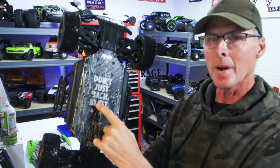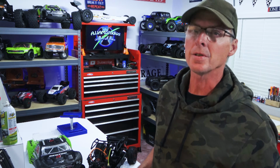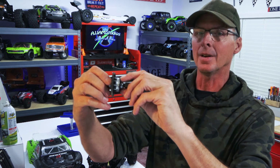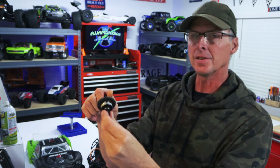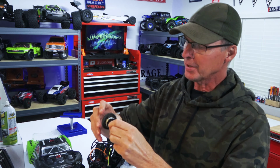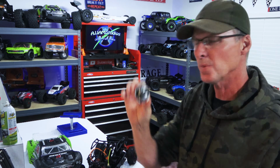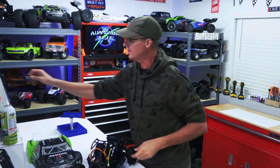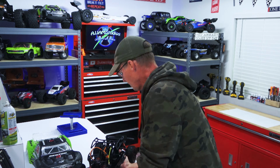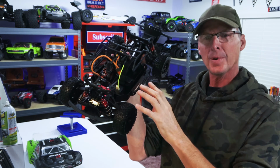But up in front of it where the barrel sits, the casing, there's no such relief right there. And once you wedge a rock in there, it binds it down pretty hard, especially if you're running 6S, because there's a lot of power there, guys. And you see, it wore this clean out all the way across there. This isn't nearly as strong as it used to be, but it's still functioning. So we could stick it in something else, but I'm afraid that same problem will happen in whatever car we stick it in. So this one probably won't get used again. Still, in order to make that work, we went ahead and replaced it with a stock one. So now it has a stock differential in it, and it's got pretty light fluid.